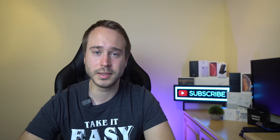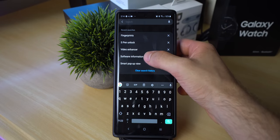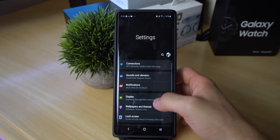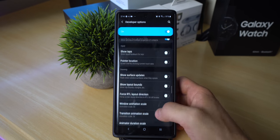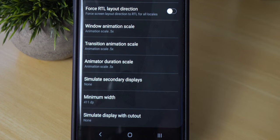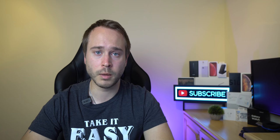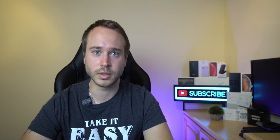The Note 10 Plus is easily the fastest phone I've ever used for everyday life, but it's not like that out of the box. Go into settings and look up software information. Click on the build number a few times until you see that you have unlocked developer mode. Then go back into settings and scroll all the way down until you see developer options. Click on it and scroll down until you see window animation scale, animator duration scale, and transition animation scale. Change all of those to 0.5 and you will see how quickly the phone opens apps and returns to the home screen. If that's still not fast enough, you can change all those from 0.5 to off — your phone will literally open apps in the blink of an eye.